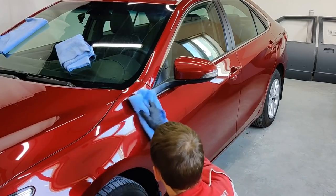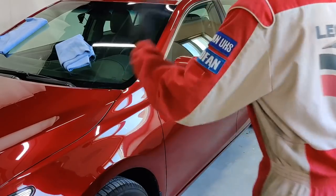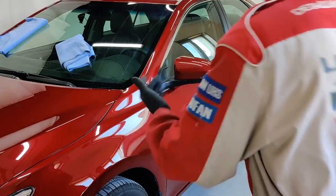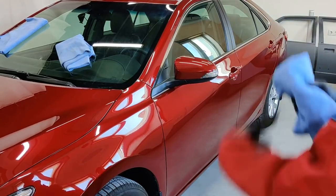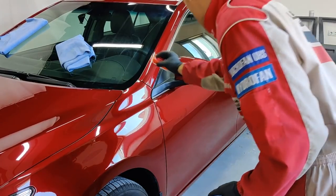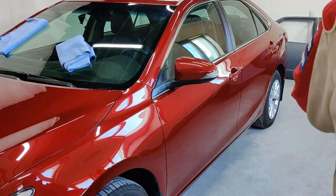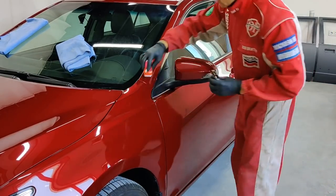Work in circles, in circles — to avoid streaks like these. Circles throughout, then finished and done — perfectly clean. After coating the whole car, take a clean cloth and go over corners, under handles — anything that shows. This product has a working time — you come back in half an hour, see something, and wipe it out. If it's dried and won't wipe out, apply product again to that spot, spread it, and finish wiping. You can apply this product two or three layers on top of each other — no problem. It's very easy to apply.